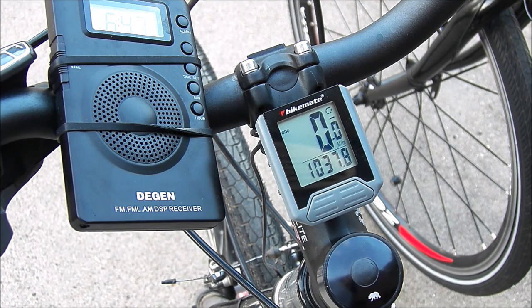Once you get that measurement, you're going to convert it into millimeters. Then you enter that into the computer, which was already in setup mode when you popped the battery out and back in. That is the most critical number you're going to enter — really the only one that matters. It will also ask you to enter your weight and height, but those are almost irrelevant. The only important entry is that wheel circumference measurement, because without entering that correctly, you have no chance of having the mileage be correct.